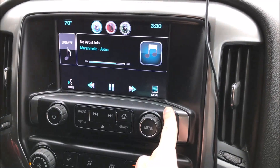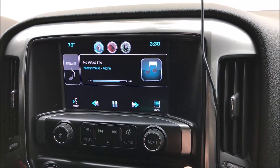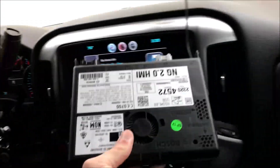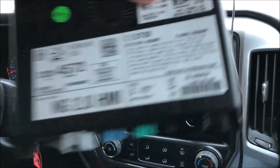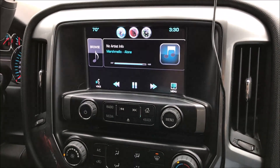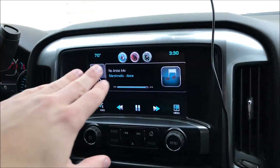You'll need your 8-inch touchscreen, and then you'll need to order the HMI box, which can come from MVI. You can talk to their tech support for more information. When you order the box, give them the last eight numbers of your VIN number, and they will program it for you and ship it to you. All you have to do is plug it in, and you will have full functionality of your 8-inch screen.